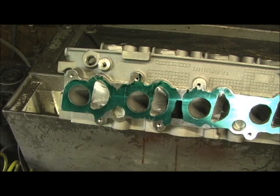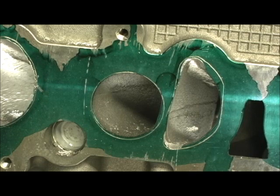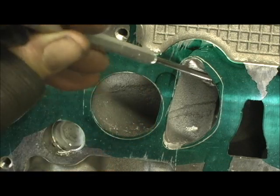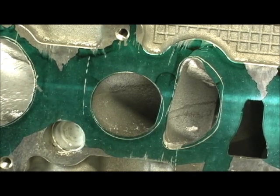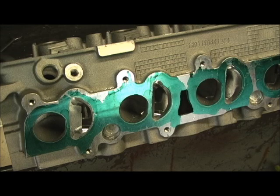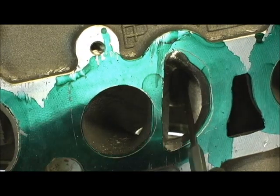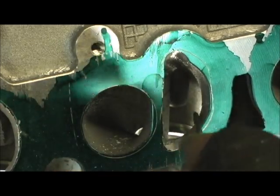On this sun and half moon deal, when you put the gasket on there to scribe it, it's a pretty good amount of material that has to come off the moon. As you can see right here, there's over a quarter of an inch, and that shape is true all the way back. It goes all the way back, so in order to get it right I'm going to have to come in here, pull that whole wall over, and pull that in to give it a more direct shot so it can do its job. Here we are trying to scope down the port, and you can see the valve guide coming through right there at the end of the point. Look at all that chunk of meat that's just covering it up.